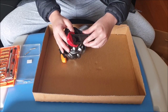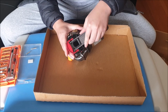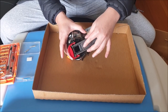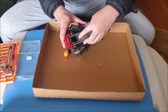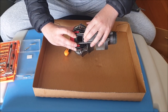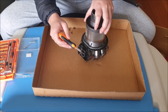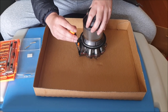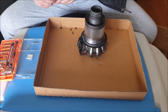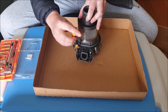When you put it back in, remember to lift up the rubber and make sure the rubber goes over the plastic. The easy way to do it is put one side in first, lift up the rubber, and then press the whole thing down. Next, you need to remove these two screws on the side — these use a smaller T6 Torx screwdriver.